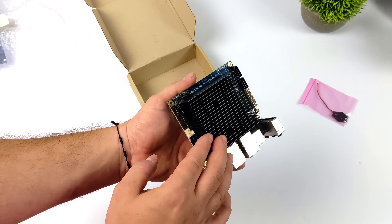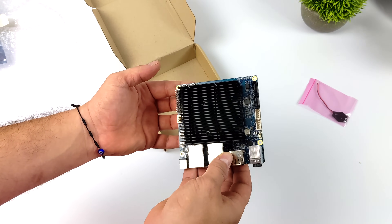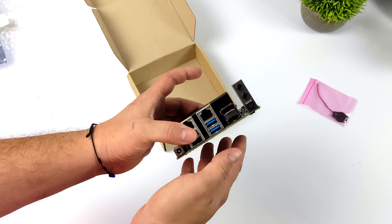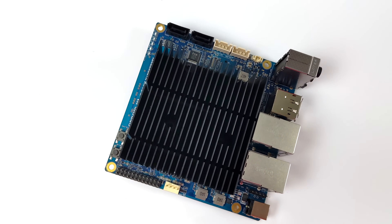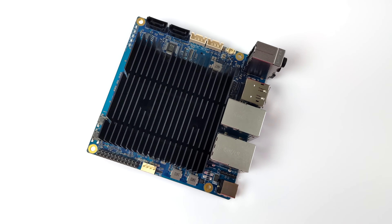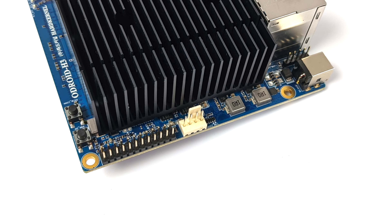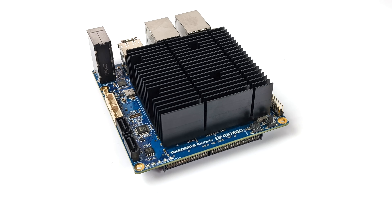That's exactly what we're going to be testing out in this video on the H3+. Since this has an x86 CPU, we can install Windows or Linux — there are tons of other operating systems supported, but in this video we're running Windows 11 Pro. I've already got an SSD set up ready to go. It does come with a heatsink pre-installed. This is passively cooled out of the box, but we do have a spot to mount a fan and plug it in — there's a four-pin connector and it's totally addressable from the BIOS or the operating system.